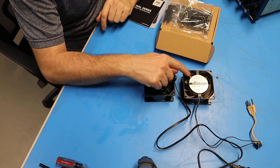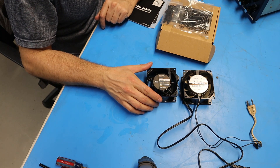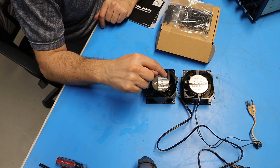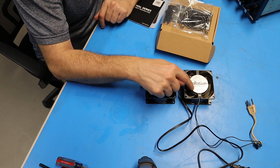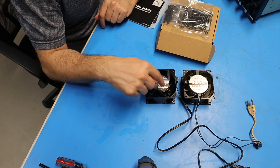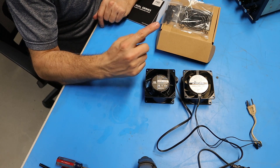Here's a look at the new fan and the old fan side by side. Physically they're about the same size and the mounting locations should be identical, so this should bolt right up to the Drake without any issue. The specs are a little different — the voltage is the same but the RPM differs. The new fan runs at 2000 RPM and flows 28 CFM, whereas the old fan runs at 3100 RPM and has a rating of about 35 CFM. So this fan will flow a little less air, which is one reason it should be quieter, but based on what I've read on the Drake forums others are using this fan successfully.